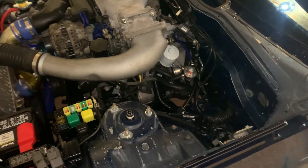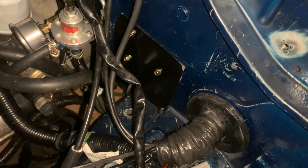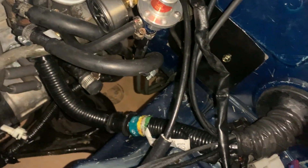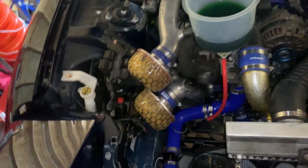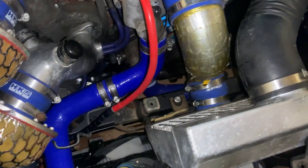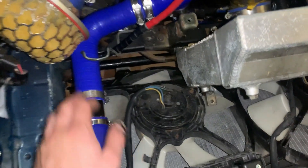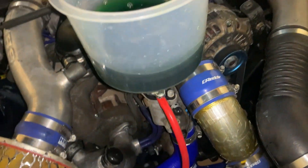As of right now I'm going to take a break. I just got that regulator installed. There's the firewall plate I got installed — definitely better than a giant hole there. Last night, or a couple nights ago, the upper radiator hose split, so I went to a store, got two elbows, and connected them. This is the repair — it shouldn't be leaking — but I just need to bleed the coolant system again.